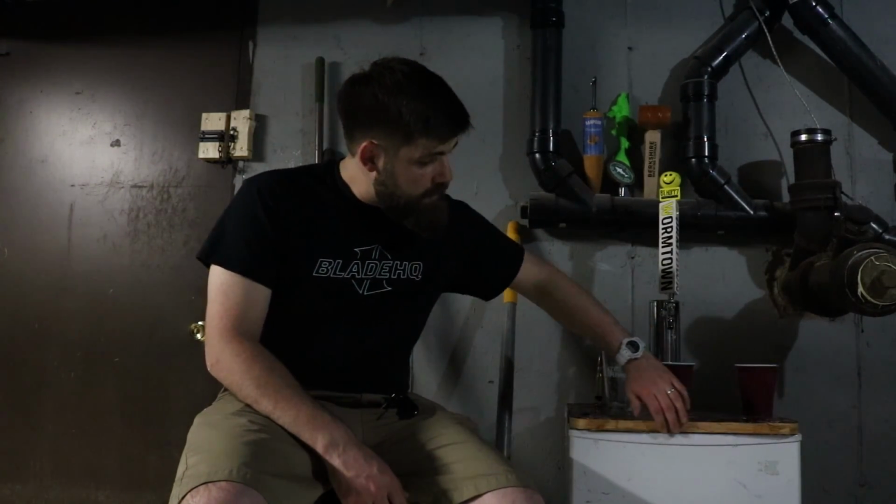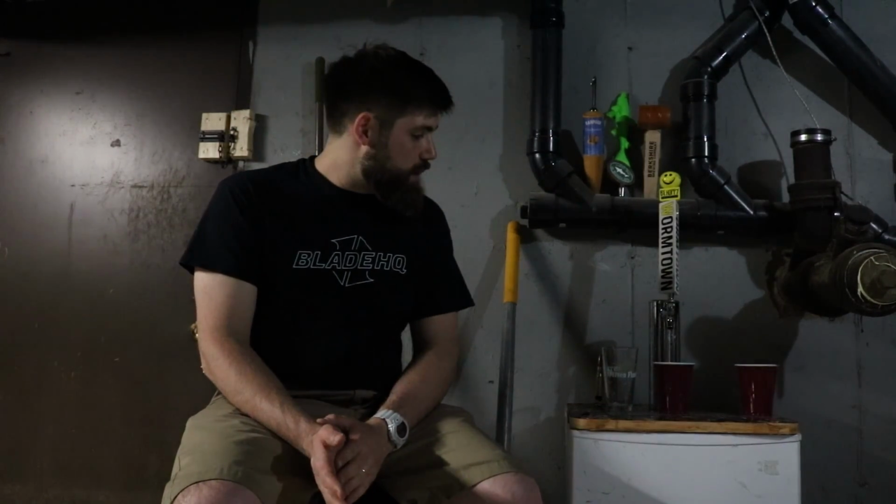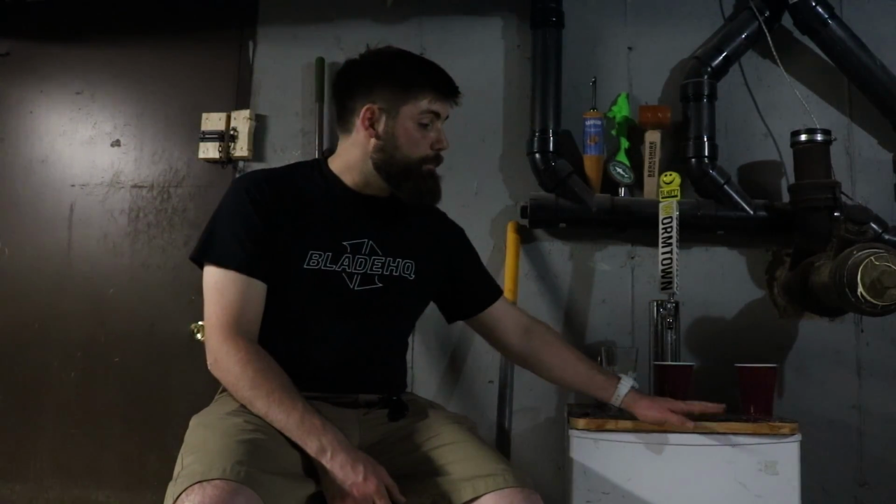I think it was an important learning for me because if I was to do it again, I would do it totally different. I would build this lip first. I did enjoy steam bending. I forgot how hard it is to steam bend wood, so that was a fun project to try again. If I was to do it again, I would build this lip, I would build the tabletop entirely, and I would seal it from the underside with some silicone caulk, something like that. And then I would pour the polyurethane on without it being on top, because that would allow me to make this perfectly level.